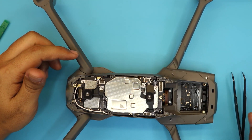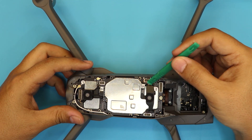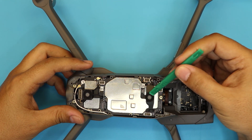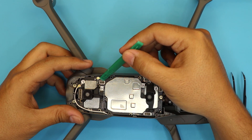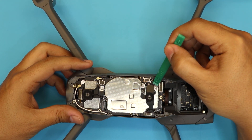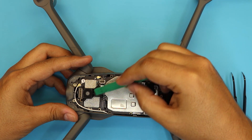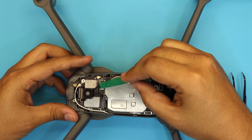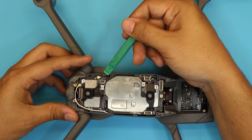Next we're going to remove the sensor cables. We're not removing the sensor cables unless you have a bad or damaged sensor. There's one cable right there and one right there. To remove it: one screw right there, second screw on the other side. Same thing for the other sensor — one screw there, second one right there. The cable disconnects from here, just lift out just like that.